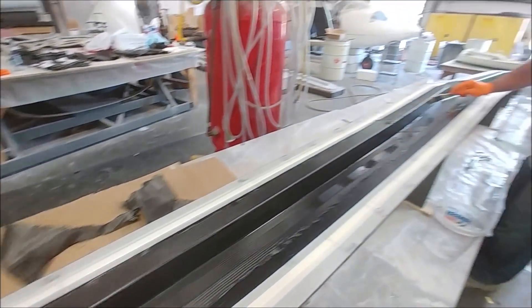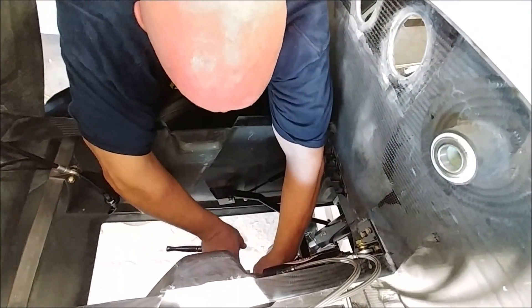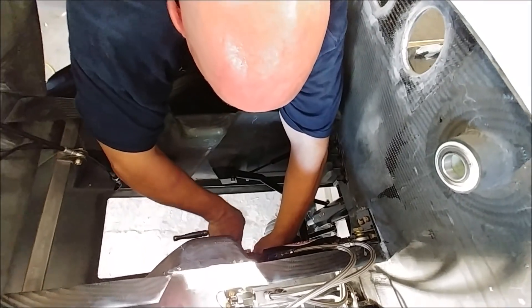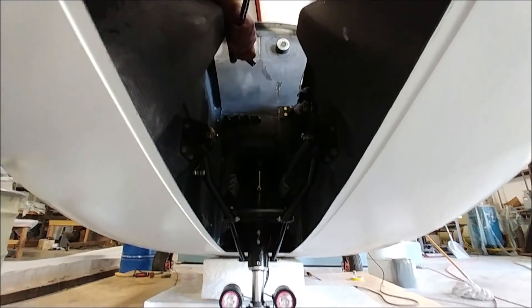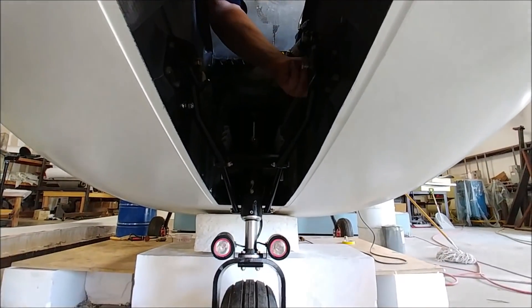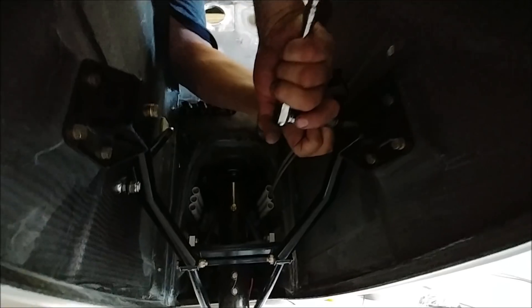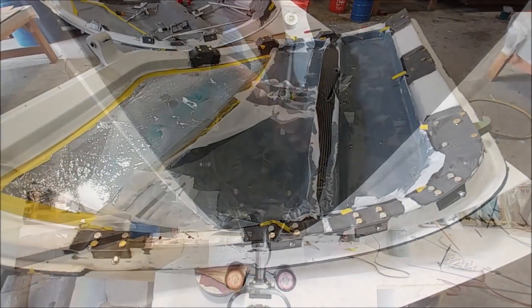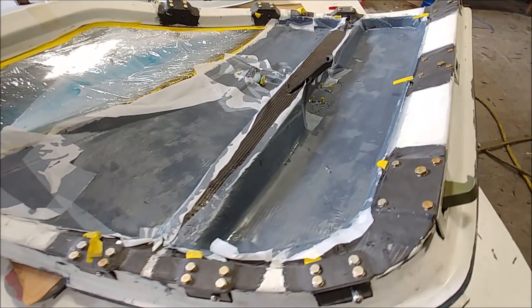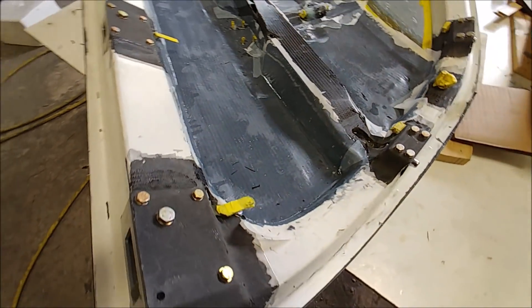Jim and I have spent this week working on the hydraulic system for the landing gear and we're getting close to having that operational, so with any luck you may actually see that in Saturday's video. Here's Jim putting in some of the bolts for the front nose retraction. And here's that second door — the bag was taken off in the morning and the guys have done the closeout layup on it, so that one's almost finished as well.